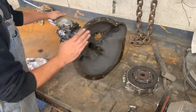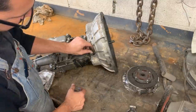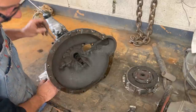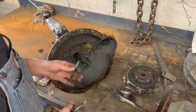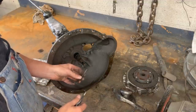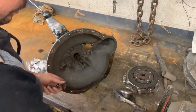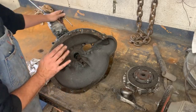Here this hole is pretty big on top, but for whatever reason the bottom doesn't have so much play. Well, it does play, but it's not as much as I expected. So maybe we'll find a bigger pin. Yeah, let me think about it. So here's what we're gonna do. This is the valve stem that's been used here forever, and I assume it's from Spitfire, and it has a little play here. We have this valve here, I guess this is a TR6, which is just a little bit thicker stem, and it doesn't go through. So